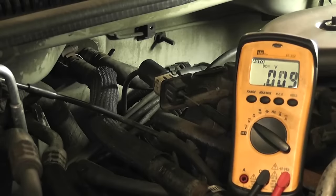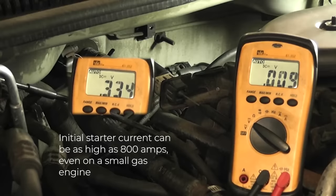So go ahead and do it. We had 190 millivolts, and I told you you want to see a hundred millivolts or less — that's generally going to be with the engine running or with the key on, engine off. A cranking condition — I'm okay with a little bit higher voltage. Again, that block voltage is actually elevated from the high amperage of the starter. So that is a good sensor ground during a crank situation.